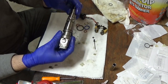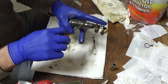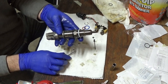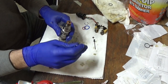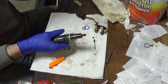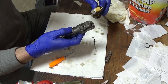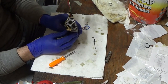Now I like to put our other o-rings on: the black one goes up top just like that, and the white one goes after that. Then we've got our copper washer. I take an 8mm quarter-inch drive deep well socket and push down on it just like that. Then, paying attention to orientation — you want to go to the injector hold-down clamp notch — we put the electrical coils on just like that. So that's how it's sitting in the engine.